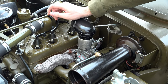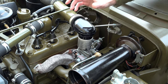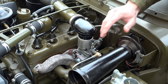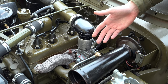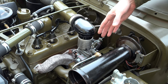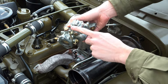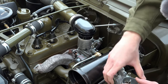The WO is a better military carburetor because it's self-contained — only cleaned air goes through it, rather than dirty dusty air coming in everywhere. But they had to do what they had to do: Solex had it, it was off the shelf, they fitted it, and as they found it needed improvements they improved it with the 32 PBIC. The PBIC uses a mechanical accelerator pump, whereas this uses a vacuum pump — very different.